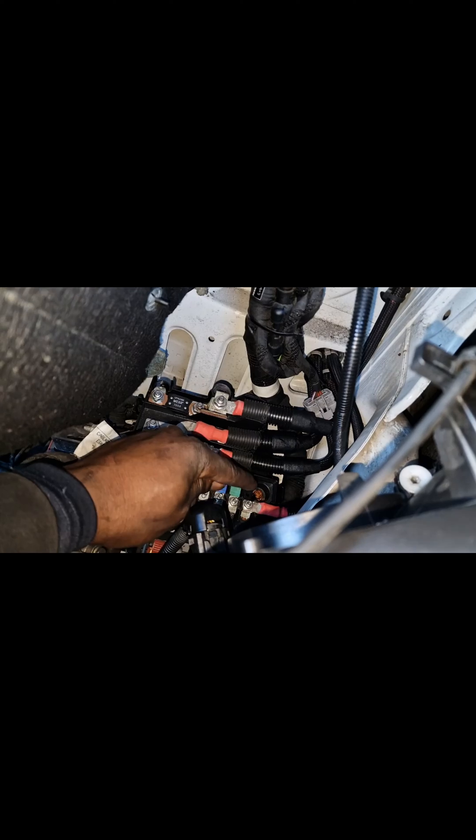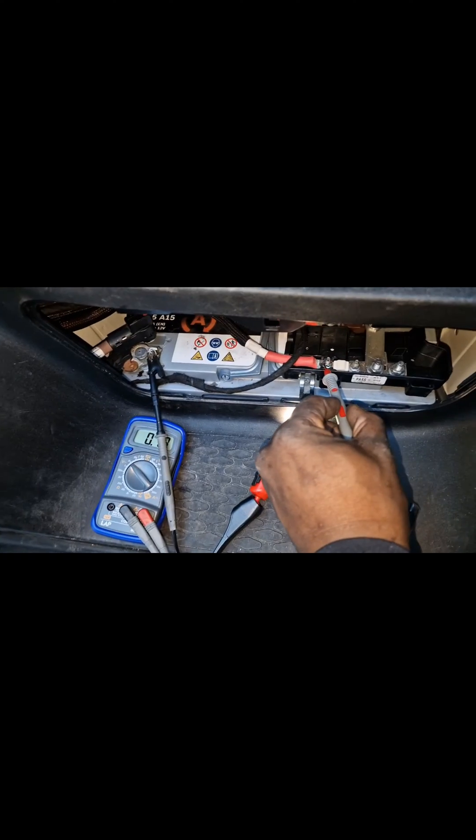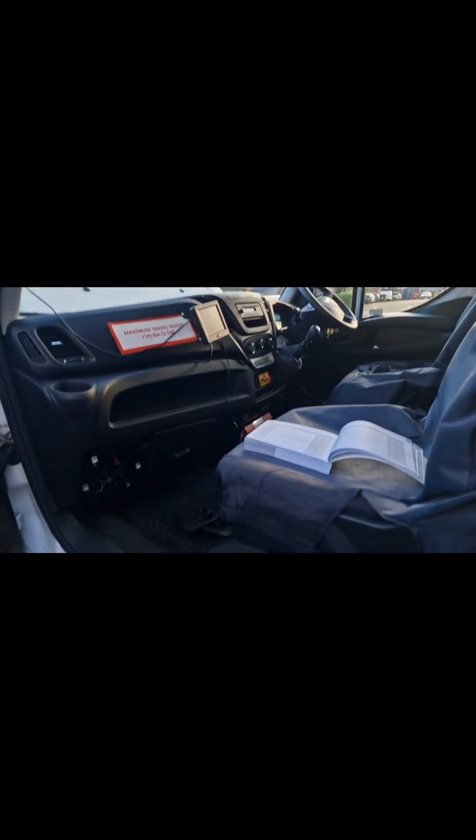One thing that I was confused about was this pin here had no power coming into it, and I should have just gone straight back to the battery. Now I'm back with fresh eyes on it again - this fuse here and that fuse there is blown. 12 volts... no volts. As simple as that. So I've just got to find that fuse, put it in, and then I've won, you know what I mean.